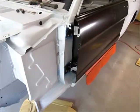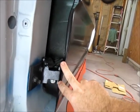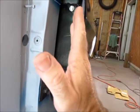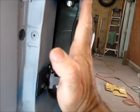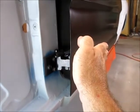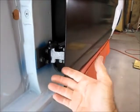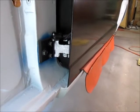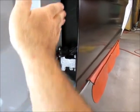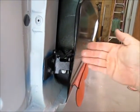I'm much happier with it now. There are two bolts up here on the top and three bolts on the bottom in the door itself — those allow you to move the door in and out a little bit, and even sideways a little. These three up here and three down here allow the door to move up, down, back, and forth. It all depends on what room you have for adjustment. On this flat plane you can go up and down, back and forth, and oscillate — you have to work within that plane.